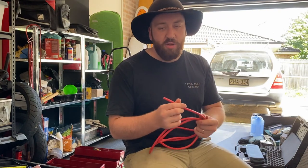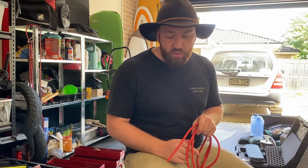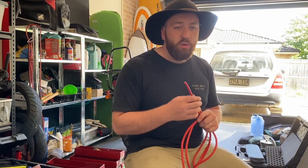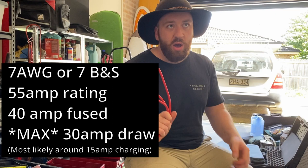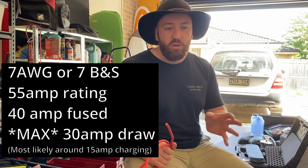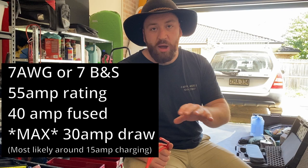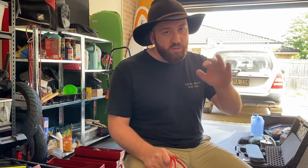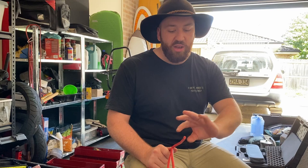This is just bigger than eight gauge wire, so it should do the trick for what we're doing. I don't plan on having the battery drain down too far - I wouldn't let it get that low with my charging - so it shouldn't be pulling too much current. Either way this wire is rated up to around 50-60 amps and I've got 40 amp fuses in there, so we should be fine. By my rough calculations the battery will mostly be pulling about 30 amps. If you're going to be constantly draining your battery down or you want to avoid voltage drop and get the full 14.4 volts through, you're probably going to want to drop down to maybe two gauge or four gauge wire.